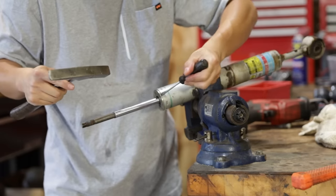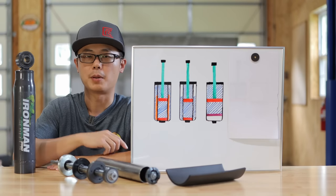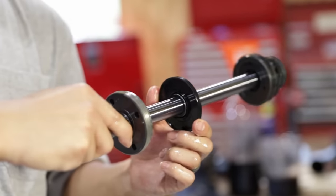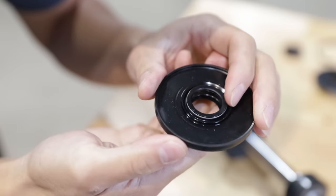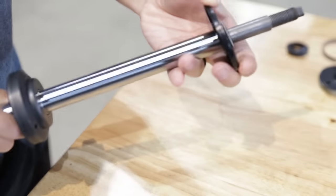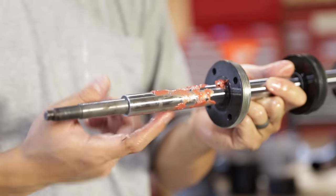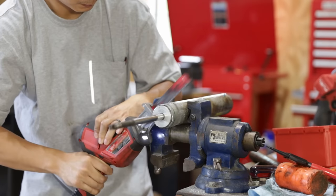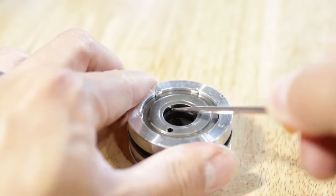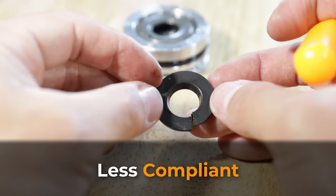Most good quality aftermarket shocks include the additional wiper seal, so the wiper seal is an upgrade from factory but nothing groundbreaking. But in addition to the wiper seal, there is also some advantage on the main oil seal design. Because this is a low-pressure shock, it uses a low-pressure oil seal design with large rubber lips on both sides, each with a radial spring to maintain sealing pressure. The benefit of this design is very low friction and wear, and the large compliant lips can also withstand more surface irregularity. Because of the low shock pressure and the protection from the wiper seal, this oil seal doesn't need to do much — very easy life.